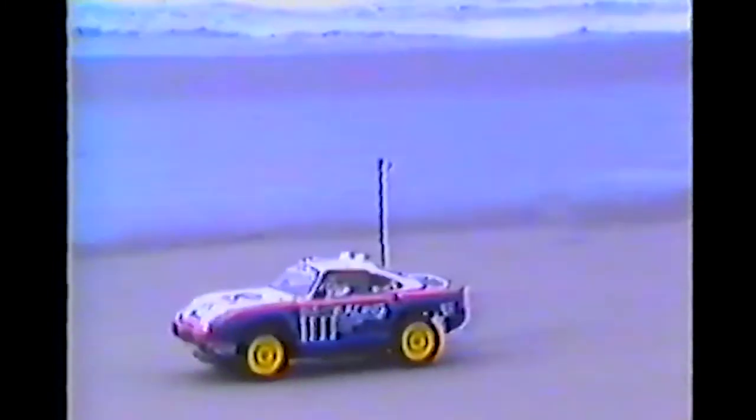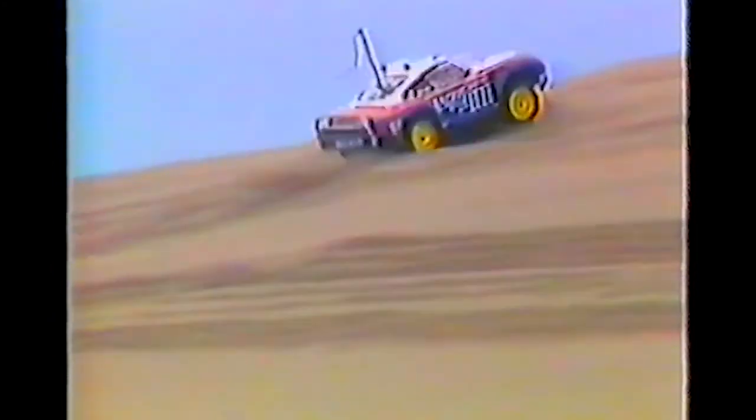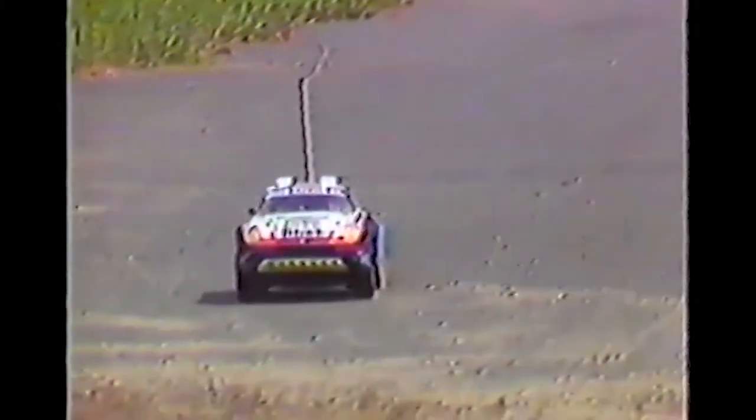A state-of-the-art chassis. The monocoque chassis is completely new in design and made from light and sturdy engineering plastics. The sophisticated, independent double wishbone suspension system is damped by four large coil springs and four oil-filled shock absorbers, each with its own surplus oil reservoir. The rear suspension geometry can be adjusted for on- or off-road performance by altering the length of the upper arm.